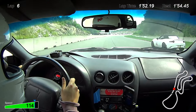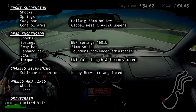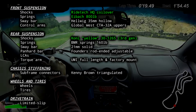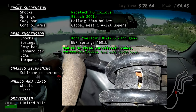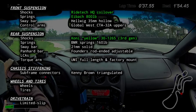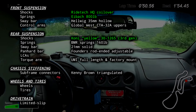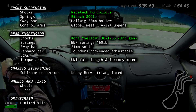It's been about three years since my first track day and I've made a couple of changes to the car. The initial track setup served me well and was decent for racking up seat time, but ultimately I wanted to go faster. The Bilsteins are gone and I now have RideTech coilovers in the front and Koni Yellows out back — both have a single rebound adjustment, but I rarely adjust the rears and do soften the fronts for street driving. You might think the 800 lb front spring is too high compared to the 160 lb rear, but the foam bump stop on a factory-style strut is an active part of the suspension when cornering, so the front spring rate needs to be increased when switching to a coilover to get the same roll stiffness. These coilovers actually ride better on the street since I'm not constantly hammering the stock bump stops like I was with the Bilsteins.